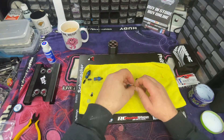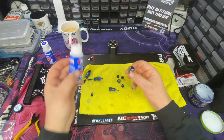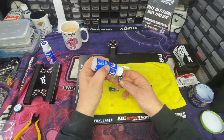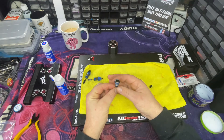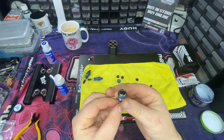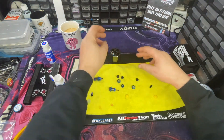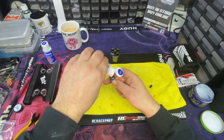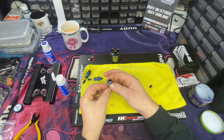For the purpose of this video I'll throw in some 10-weight oil that'll probably go in. I'm going to fill it pretty much to the top of the shock body, gently push the piston through the oil, and pull it down gently again just to get the bubbles from underneath. Just work it up and down a few times. Then that's going to sit in the shock stand. Repeat the process for the other shock.